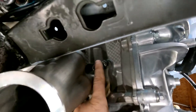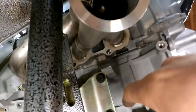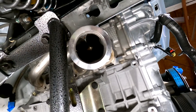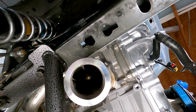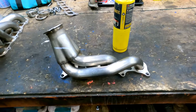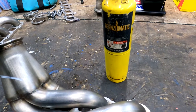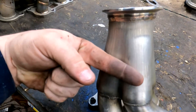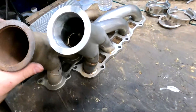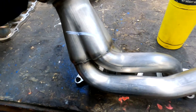The other one wouldn't even come close. I just got to bolt it in in three spots. I got the two studs in on top. I did have to cut one down to be able to slide it in because the passenger side is a lot tighter than the driver's side. I got the two top studs in on the corners and one header bolt pushing it down, because if you have just the top two bolts in, it'll rock the flange — tighter at the top than at the bottom. So I bolted it top and bottom just to get a better idea. Let's go ahead and get this pulled back out and we'll heat it up. I don't like the way it looks when you just bash it with the hammer — it looks kind of hacky. So I'm going to try and make this look as professional as I can.